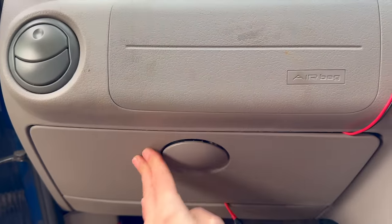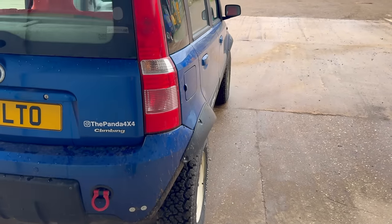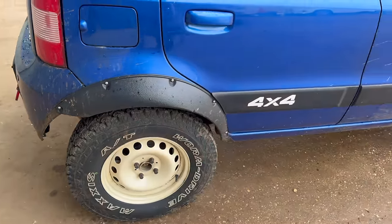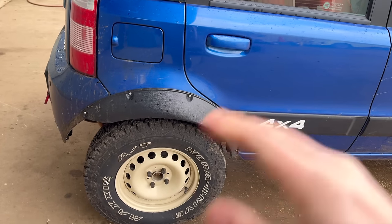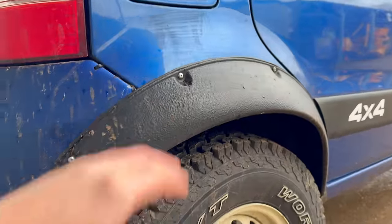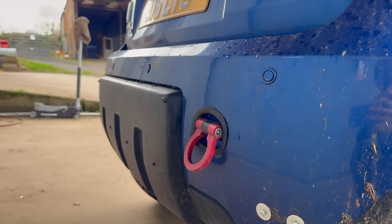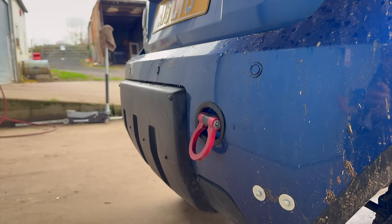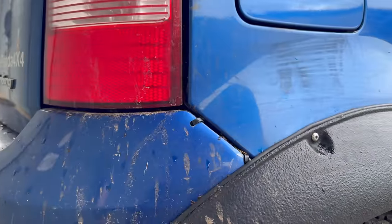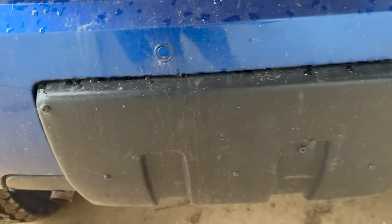At the rear of the car I had to do a slash cut on either side of the bumper for wheel clearance. The front arches are single-skinned but the rear ones are double-skinned, so it is a little bit more difficult to cut — but once you cut it off you get plenty of clearance and the arch trims finish it off nicely. I've got a similar tow hitch at the back which I'll probably change eventually. On some off-roading trips I've ripped off the rear bumper, so it's held on by some screws and the obligatory cable ties.